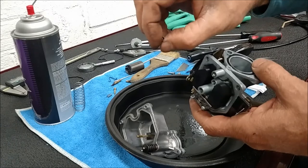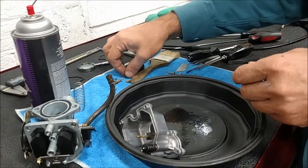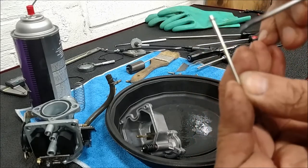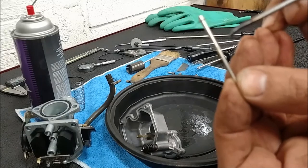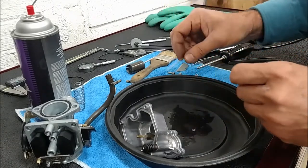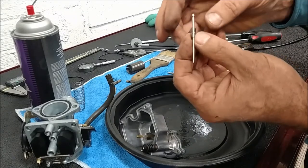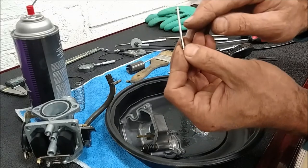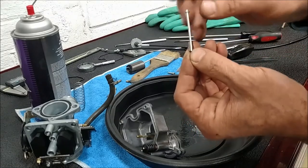There is an upside and a downside to the needle jet. This carb has only had fuel in it for about a month of sitting. The first place that varnish is going to form is right here on the slide needle. Right there is a ring of varnish - that is quite a lot. That is enough to clog up fuel flow at idle and make it run very lean. The needle jet is the other half of that fuel circuit. When the slide is closed, that position is the evaporation point for fuel in the float bowl. There is going to be an equal amount of varnish on the needle and inside the bore of the needle jet. Both have to be cleaned out.